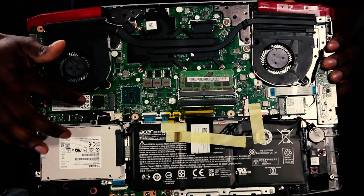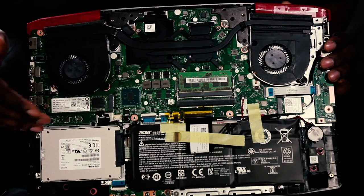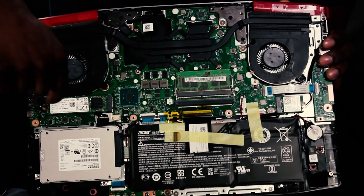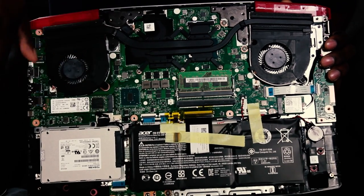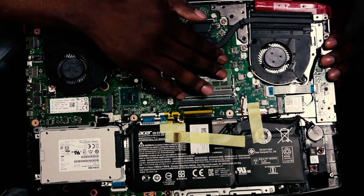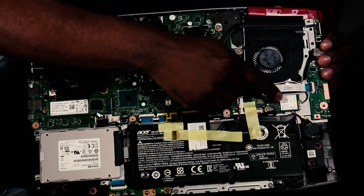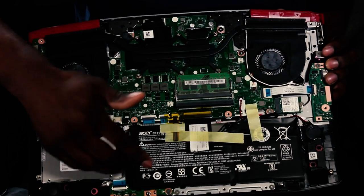So you can unscrew it and you can put your own faster NVMe if you choose that you don't really want to have that. It's so simple. You can unplug this to connect the SATA cable out and connect to this SSD in. And NVMe is a screwdriver away, unscrew, and then it flaps up, then you pull it out and put a new NVMe in, and the RAM is just kind of the same. You just pull the sides out, and then you stick your RAM in, no problem. Everything's all connected, then you've got your Wi-Fi and your Bluetooth connected onto the motherboard as well. All your connections and stuff like that.